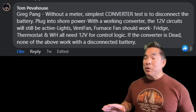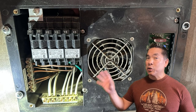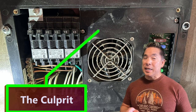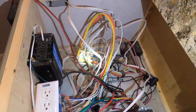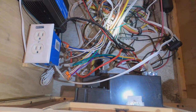So I knew the converter was bad, and I ordered myself the WFCO 8735AD to replace the one in the R-Pod. In the R-Pod model 180, the power center is located below the rear dinette seat, fortunately with ample room to work and extra cabling. Unfortunately, the converter is integrated into the black power center, so you can't just disconnect and replace the converter — you have to replace the entire power center. Let's start here and take a tour of the wires going into the back of the panel.